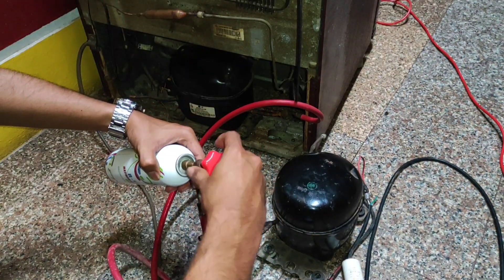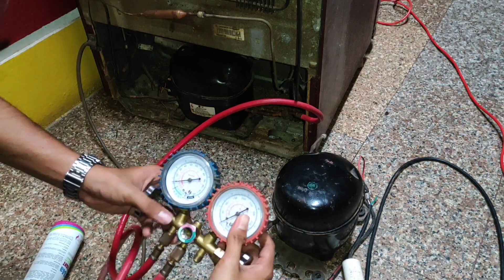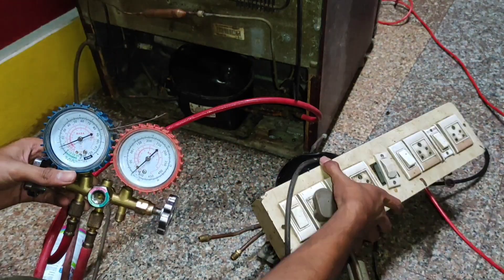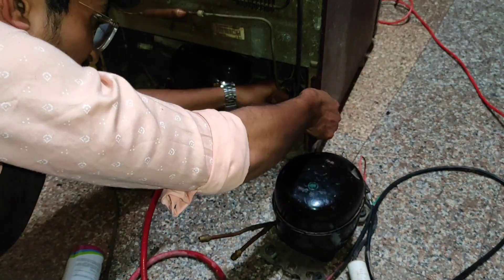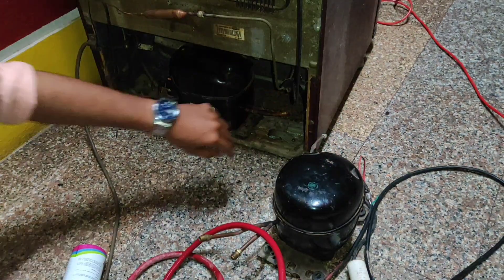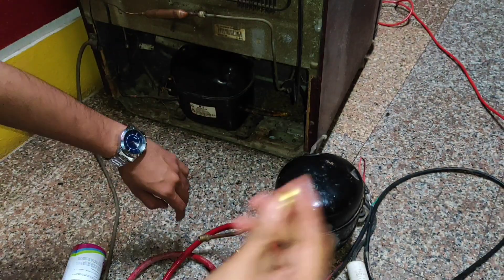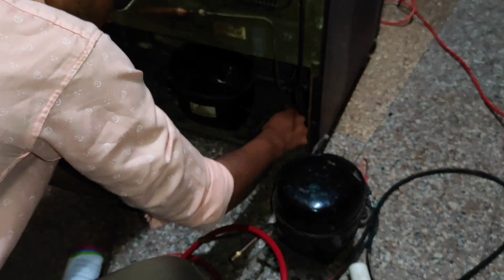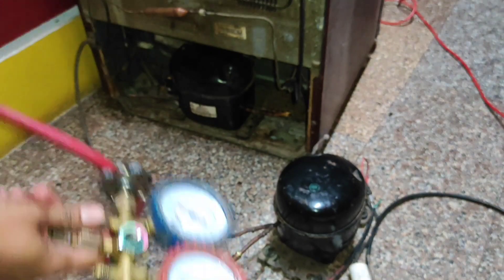After completion of gas charging, we have to turn off the gas valve. Here you can see it is now around 10 psi. I am going to turn off the refrigerator, and after turning it off the gauge will move upward. Now I am going to remove the pipe from the compressor. After that, check whether there is a leak at the pin valve — sometimes the pin valve also leaks. Apply some solution and check for leaks. After confirmation, you can put the cap on the pin valve. If you like this video, please like, share, and subscribe to our YouTube channel. Thank you for watching — see you in the next video.